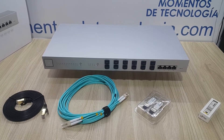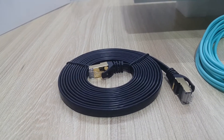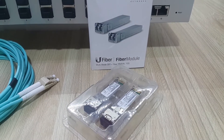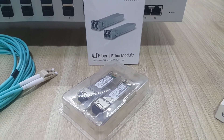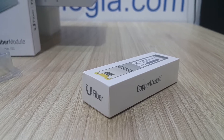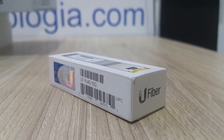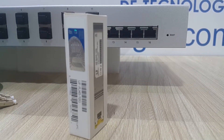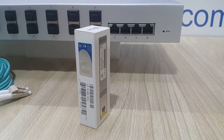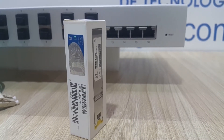So you're going to be able to use uninterrupted power supply units in the back. Right here is our kit for 10 gigabit. We can use Category 7 or Category 6 as UniFi suggests, and OM3 fiber optic cables — this is in order for you to get the real power of 10 gigabit. We have two module options: SFP Plus for fiber optics or RJ45 copper modules, which are going to let you connect Category 6 cabling to a 10 gigabit backbone network, adding up to those four ports included in the switch for a customized, mixed technology of fiber optics and copper in your network.